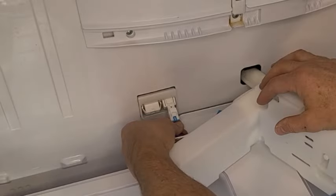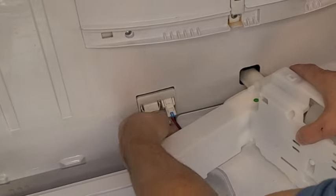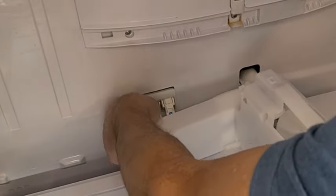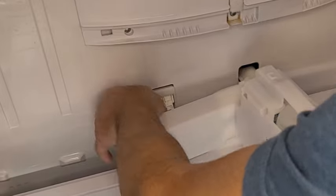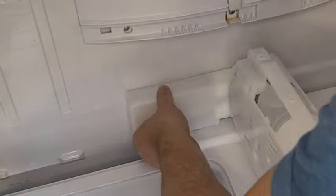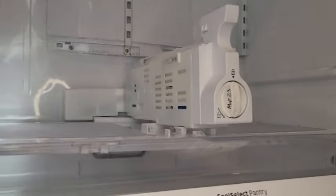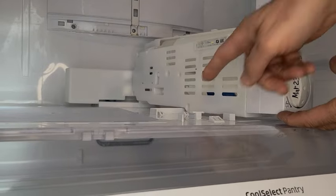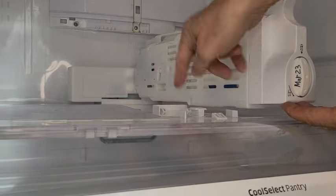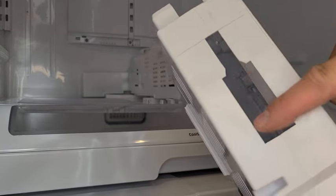You plug the new lighting connector into the top right connector, then plug the other connector into the left, and you're all set with the electrical connections. When installing the new unit, notice that there is a T-shaped post, which you'll insert into this slot on the bottom of the unit and then slide the unit back.